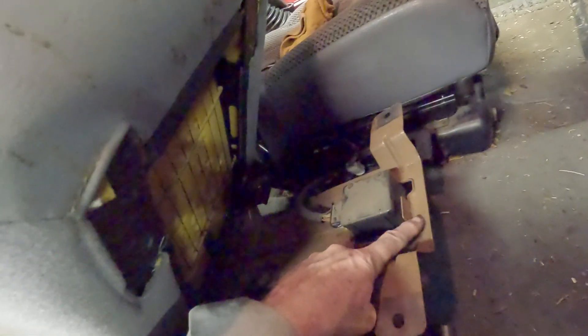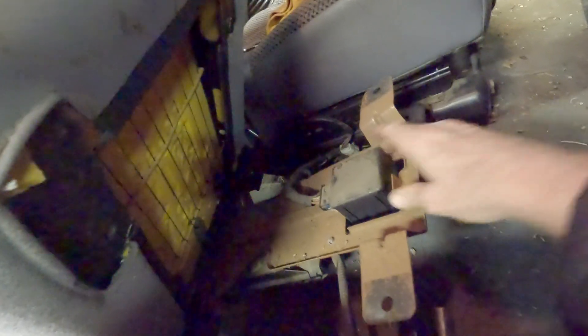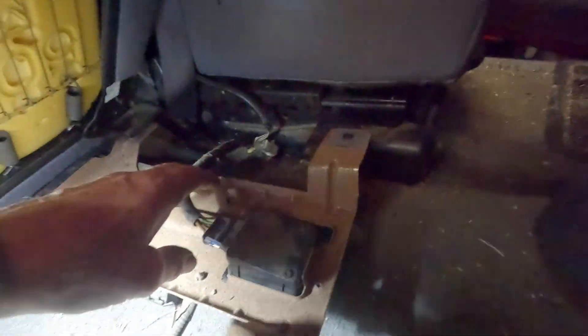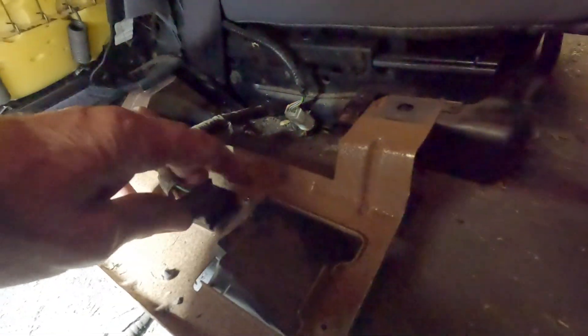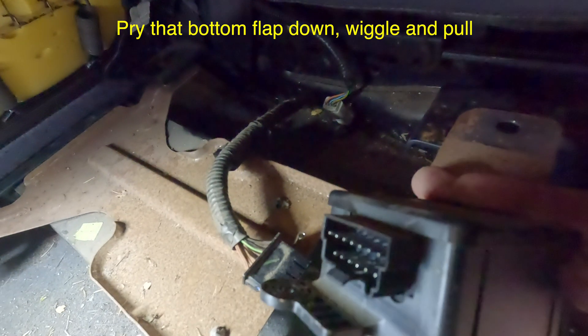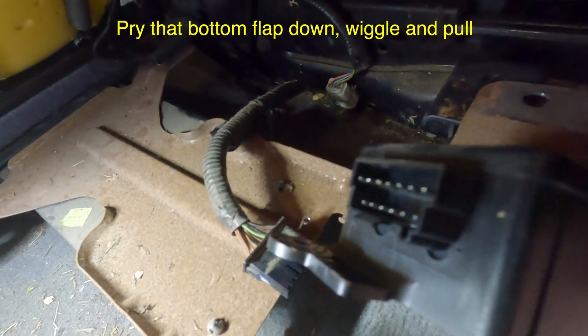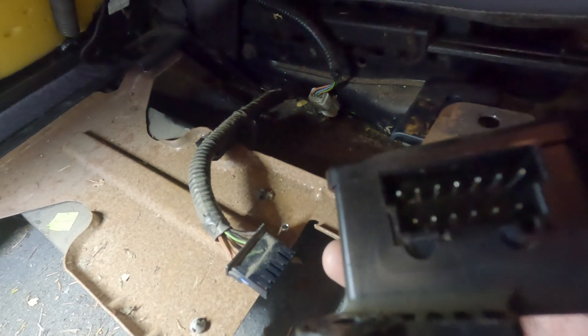There are two Phillips head screws, so I'm going to get a stubby screwdriver and come from beneath — put the screwdriver under here and release this module. Once those two screws are undone, this connector just comes off. I'll try and move my hand out of the way so you can see it. There's a little flap on the bottom, but basically I just wiggled and pulled and it came out.